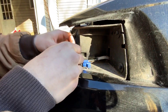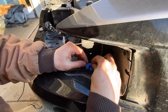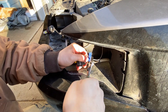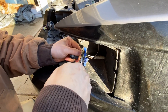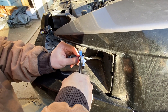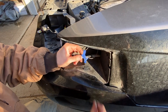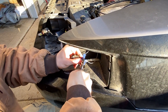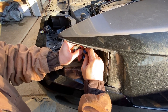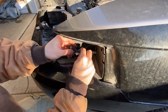Take your middle wire and put it in there. Then take your pliers and squeeze them down until you feel it go through. You'll notice that the wire won't come out anymore. Just give it another little squeeze — not too tight — and then flip this over. It should snap closed like that, so it keeps that in there.